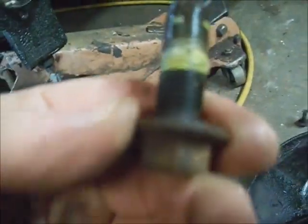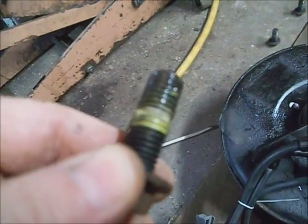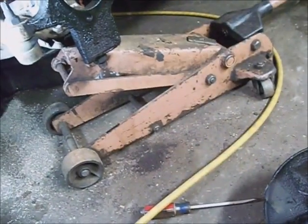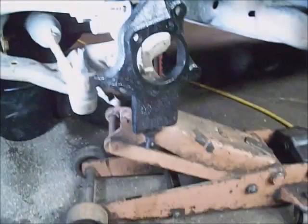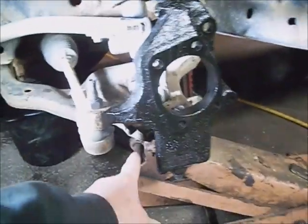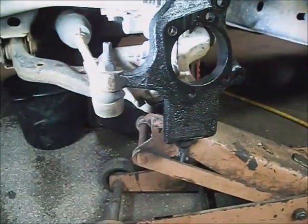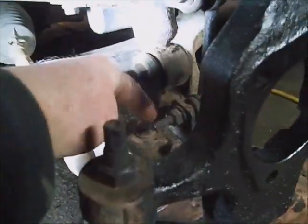I went ahead and freshened up the old wheel bearing bolts with some blue Loctite, all 4 of them. And I'm going to go ahead and feed that through there and start getting some bolts in it. The control arm's still raised up by the jack, level, so I can get at this lower bolt underneath of this stabilizer stud. Once the rotor and wheel bearing are installed onto the spindle and tightened down, then I'll be tightening the hub, the rotor bolts to their final torque.